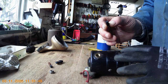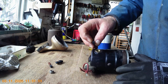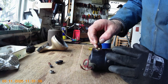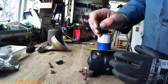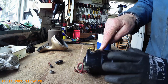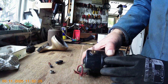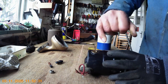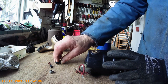So try and get them in correctly. It was always suggested to put them in exactly the same position they come out — the same angle. Hoover always used to put a little mark — a plus or a minus — on the brush if you take an old motor apart, so you could get the brush in exactly the same position. The trailing edge usually exhibits a burning mark and you can tell which way to put the brush back in. If you think about the motor going clockwise looking from the fan, the trailing edge will be on one side — so look at the brush and put it in exactly the same as it came out, then you should have good commutation.